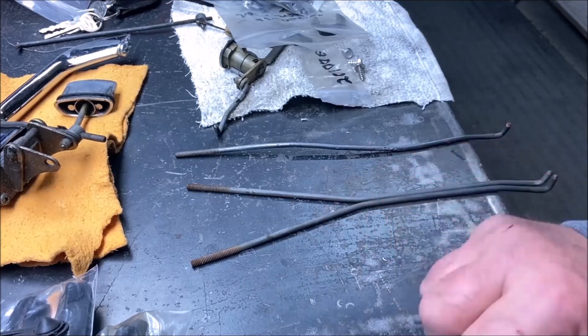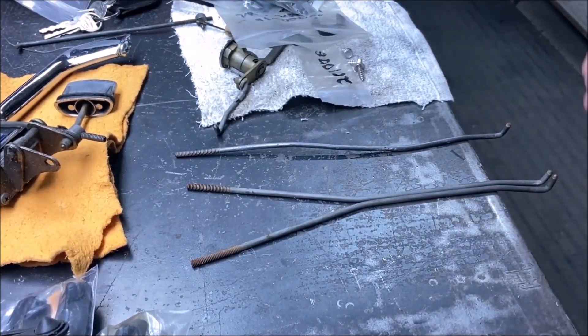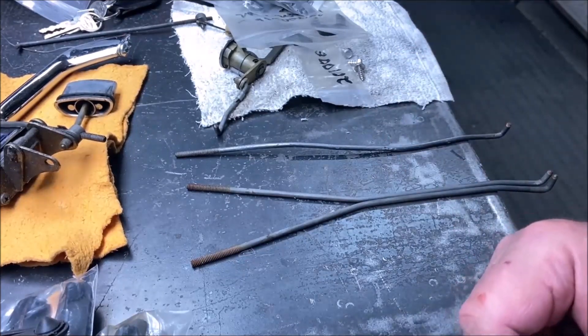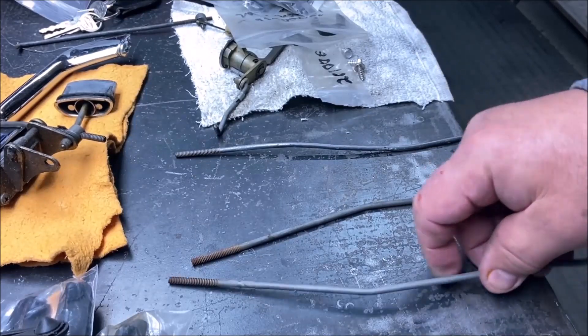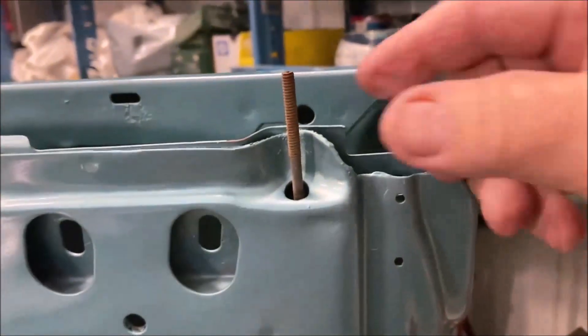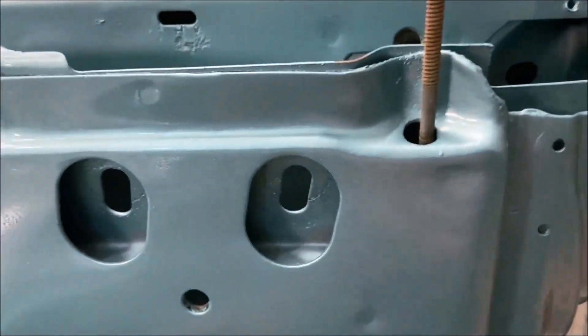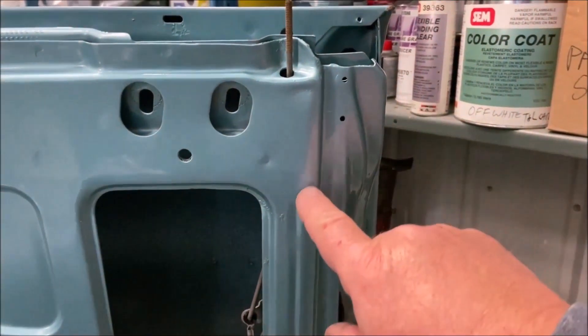When you put the door panel on, these should not be binding on the door panel — that's a common problem. You put the lock knob on and then you can hardly pull it up and down because they bind, and that's because the rod is bent. These should go through the door panel and the lock knob should be able to be screwed on easily. Here's the rod — I put the rod in, it's not latched yet. It's straight up and down, loose in the hole. See how it goes in and then comes backwards and then up — that's how it's bent, that's the way it's supposed to be.